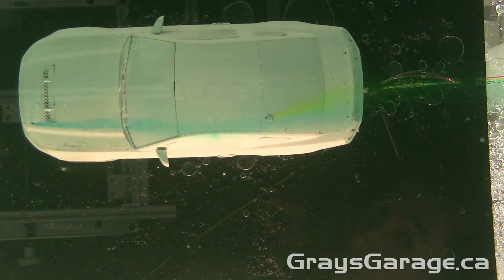For a final investigation, we now have a different viewpoint where we can see the locations of those dye ports. One thing to note: observe how the green dye along the rear windshield is being deflected inboard — it's not actually following the lines of the vehicle but is being pulled inwards towards the centerline. This indicates some sort of flow phenomenon causing a redirection of the flow, which is quite interesting.